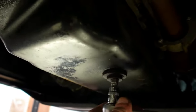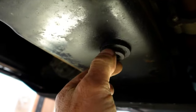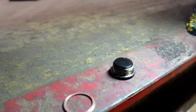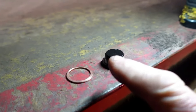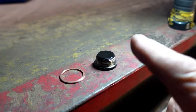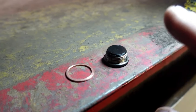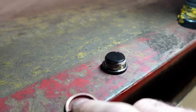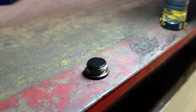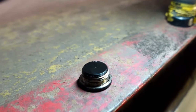There he goes. Just break that off. I'm just going to get my oil pan. With the oil drainer situated right underneath, we're just going to remove that plug - I've actually put a glove on now. There's all that black oil. So for anybody that doesn't do this very often, on this plug will be a copper washer. It's advisable to actually order a copper washer to go on your sump plug for your vehicle if you want to change that. I did not actually order one up, but I've got one in a box of multi-purpose washers. Not that it was leaking anyway - there wasn't any problems there, so they normally don't give any issues.